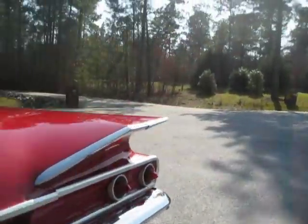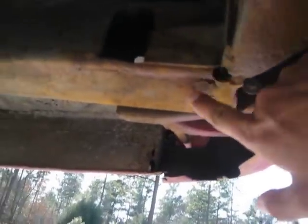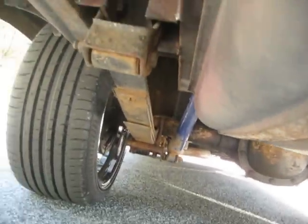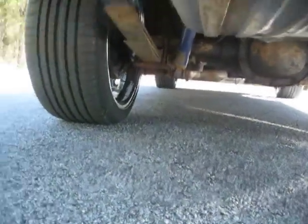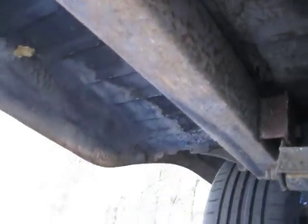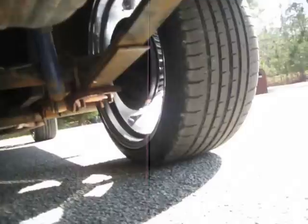The backs of the quarters look pretty good. The trunk is in really good shape. Underneath the back, you've got a couple of spots of rust — a small hole there in the back — but nothing that means you'd have to replace the quarters. I think honestly, if it was me, I'd just drive this thing. You've got one spot of rust right there that you could real easily cut and weld. I think it's got a shortened axle on the back. We put some pretty fat tires on here and you've still got tons of room, so you could put really big tires on here if you wanted to. It's got a locking rear end.